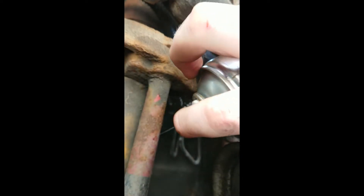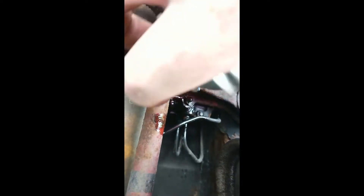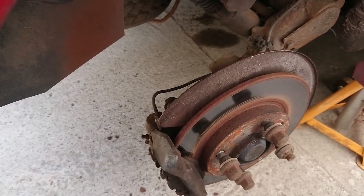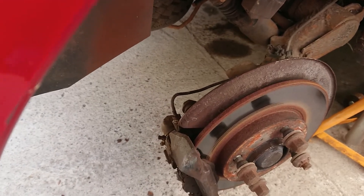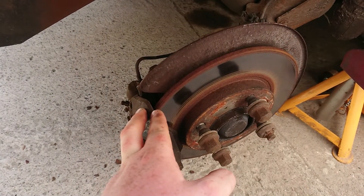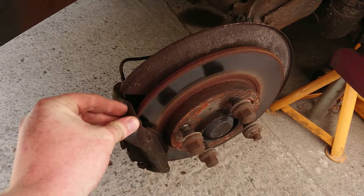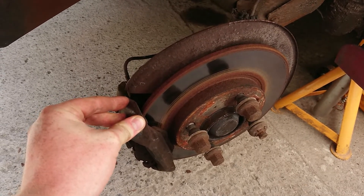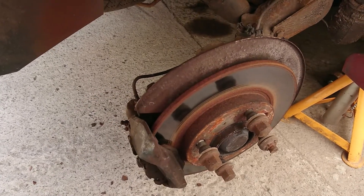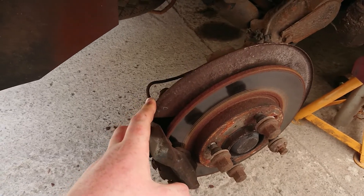The ones I'm concerned about are the ones on the brake lines, but we'll lubricate these regardless. I'm going to remove the brake lines from the brake bias valve, so that's where I'm going to lubricate. With a bit of further investigation, I think I've come to a conclusion: my 106 has a little bit of play in the rear axle. I cannot get anything off this, so what that leads me to believe is that the axle hasn't got failed bearings — the actual axle is bent.